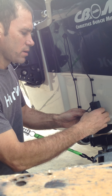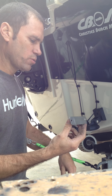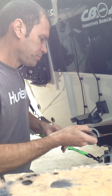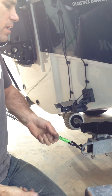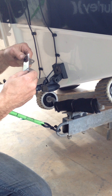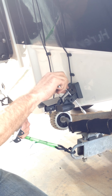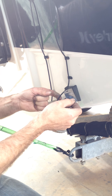In this case, we've got this bolt here. What we came up with was a two-part guard — one that's got a bridge, and it's got the guard itself, which bolts to the bridge. The bridge goes on there, and it also prevents water coming up through this gap here. If you notice on yours, water could possibly be streaming up through that gap — it's quite large — so this bridge will stop the water coming up there as well.